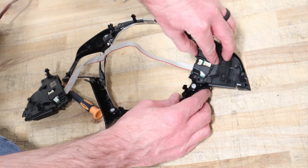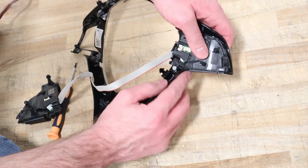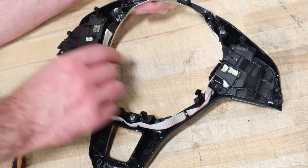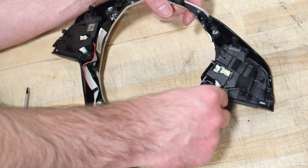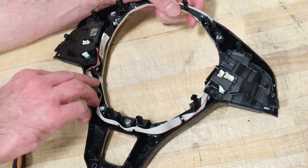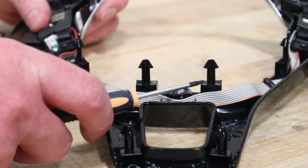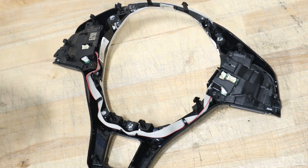To install these, I'm going to go the opposite way — just hook these in place and then pop that down. You should kind of feel it sit down. You have to spread open the trim a little bit to get that in place. When you pop these in, you want to get this ribbon down below here. What I tried to do as I was running this around was make sure that the flat portion of these barbed areas has the ribbon at least below there — those are stop points for these mountings, so the ribbon height must not go above that. Anything above that could get pinched.